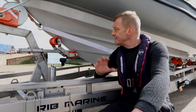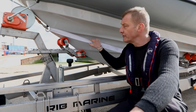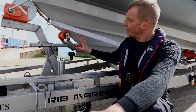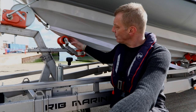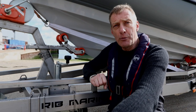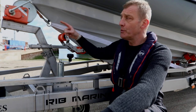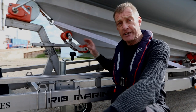Next, we look at how the boat is strapped down. There's a strap pulling it forward and a strap pulling it aft. The attachment point — the headstock — hasn't been set for this boat. We really want the headstock either side of the D-ring so the whole boat is held into that fitting. To achieve that, we need to raise it and move it forward. While it's only being moved around the boatyard they've used a strap to stop it going forwards and one to stop it going backwards, but ideally the boat should be sitting between the rollers — we'll see that corrected shortly.